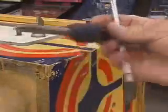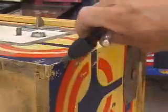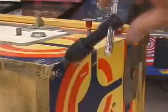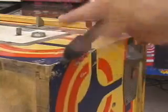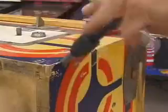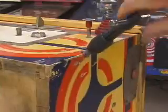Before I install the legs, I like to run a 3/8-16 SAE American thread tap in through my leg plate. And then I can clean these out in case some bonehead put a crappy bolt in there and tried to strip out the threads. This, in a lot of cases, will clean up the threads enough so that they'll be strong enough to support the leg bolts. Sometimes this trick won't work, and you'll have to replace the internal leg bolt plate.